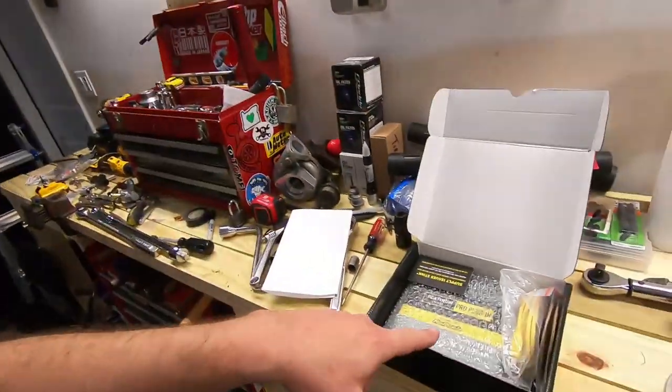Haltech and their tech support, trading back pinout diagrams and doing all kinds of verifications, the Stagea wiring harness can plug directly into the GTT. Everything's exactly the same. We verified all that. The only difference is 4 out of the 6 injectors, their wires just need to be flip-flopped inside my wiring harness to interface with the ECU, because technically this is set up for a Neo.